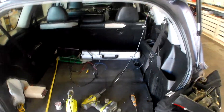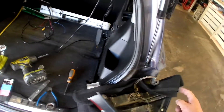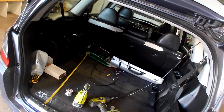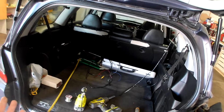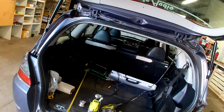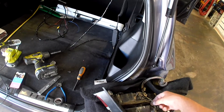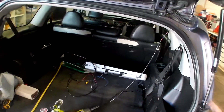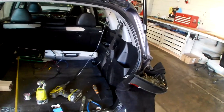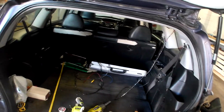Some cars — Toyotas are really good for having signals up the front, Nissans too — it does vary. Have a look at the front; if you can find it great. Sometimes you will find the same colour — the green or the black trace in this case — up the front. You can go down the door sills, sometimes you find it there. In the kick panels, both sides — remembering this is a right-hand drive car, so it might be on the driver's side, whereas on a left-hand drive it might be on the left side. Always always check it, and don't assume that just because it's one colour at the back it's the same at the front, because there are only so many colours and stripes available, and somewhere along the line they're going to double up. Once you've found it and you know that's the right one, you can spend 10-15 minutes at the front probing those coloured wires and seeing if you can match it up.